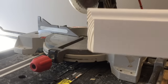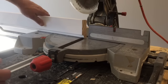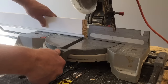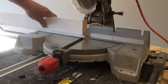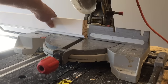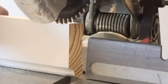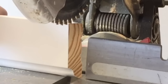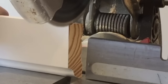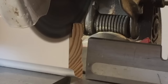I'm going to flip the mating piece upside down and put it on the miter saw fence. Then I'm going to adjust my miter saw to anywhere from 5 to 10 degrees back — you'll see why in just a moment. I'm going to give this a little relief cut, making sure I don't take any of the primer or paint or go past the edge of the molding. I'm going to cut it just down to where it starts to curve.